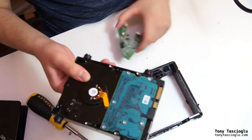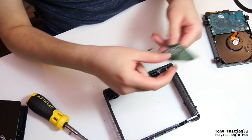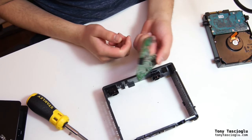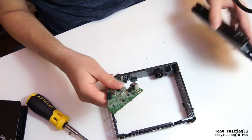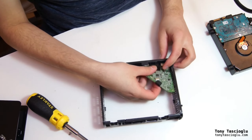Then you can just unplug the USB to SATA bit. You might be able to reuse this adapter for other drives, but WD seems to be locking the firmware so you cannot reuse it — for example, if you put a Toshiba drive in this enclosure it won't recognize it; it has to be a WD drive. Unlike Seagate enclosures where I have been able to do that.